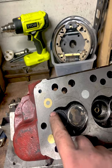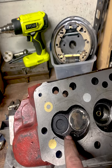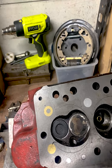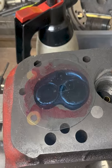Because this is going on a turbo engine and it needs an 8 to 1 compression ratio. So we've marked out the shape of the combustion chamber. We're going to get this one out to 22cc and then we'll copy that on each other combustion chamber.